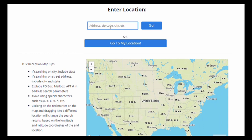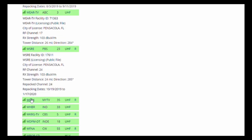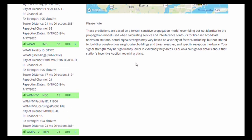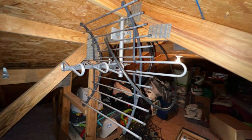You'll just enter your location here, or click the 'Go to my location' option. I'll enter a nearby zip code to show you how it works. After entering your location, go ahead and click on each of the stations you would like to receive on your TVs — I'm going to select all of these stations in green. As you can see on the map, most of the stations are located west-northwest. If you're not great with directions, I recommend clicking on a station that is sort of central to all the others and determining the angular direction as shown here. Then you can pull out your phone's compass app and find the degree you need. After that, just make sure you mount your antenna pointing in that direction.